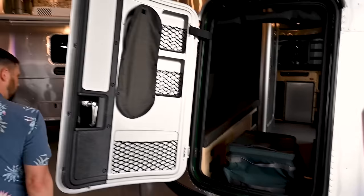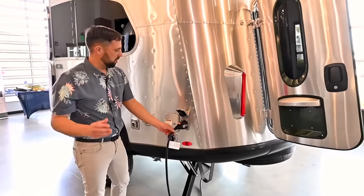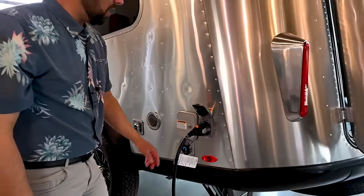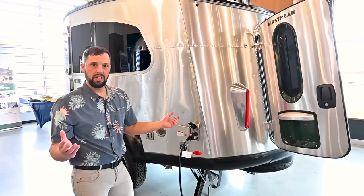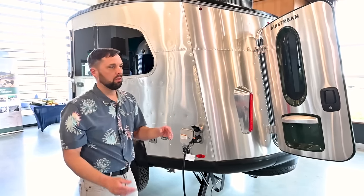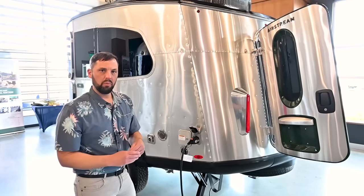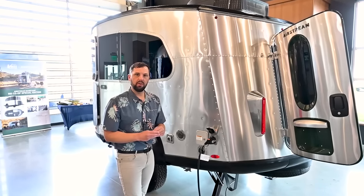Coming around on this side, we have the shore power connection. This is a 125-volt, 30-amp shore power trailer. You'll need 30-amp full shore power if you want to run everything — microwave and air conditioning. At Colonial Airstream we give you an adapter that steps this 30-amp connection down to a regular 15- or 20-amp outlet for most things. One thing you shouldn't be able to run would be the rooftop air conditioning. We do sell soft-start capacitors that lessen the load on initial startup, which could potentially allow it to work on a 20-amp outlet, but best case you always want to plug into 30-amp.